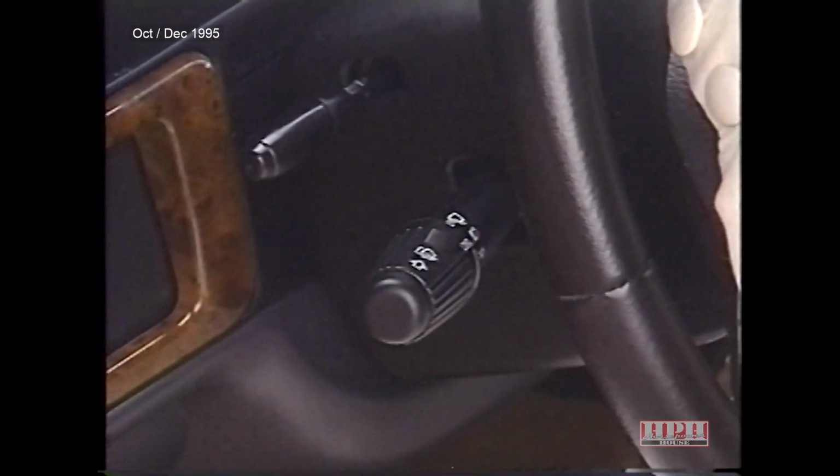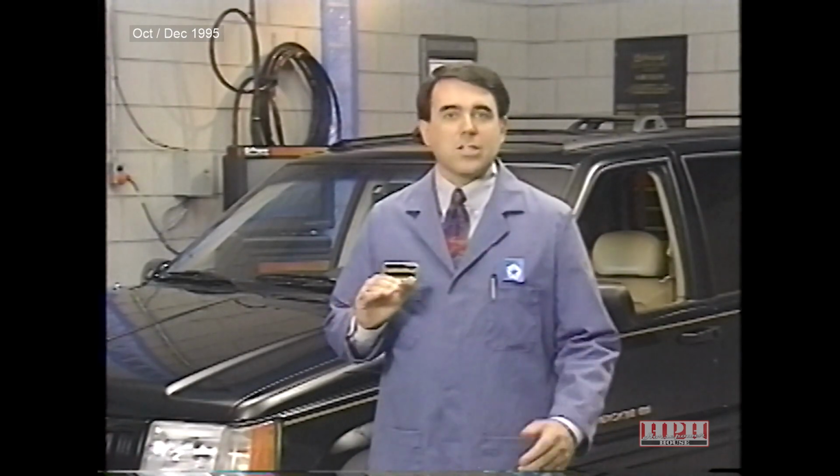Regarding the wipers, intermittent wipe delay times are now speed sensitive. Above 10 miles per hour, the delay is adjustable from about 1/2 second to about 18 seconds. The BCM doubles the delay time when the vehicle goes below 10 miles per hour.